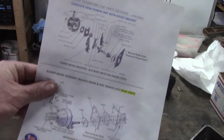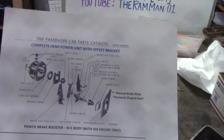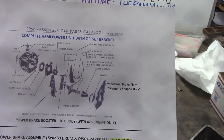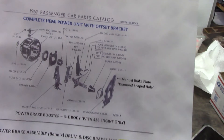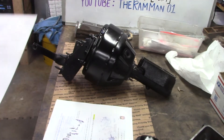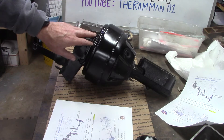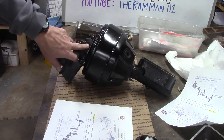Here's a blow-up diagram I've done for people. A lot of people say that they have a Hemi booster or Hemi brackets, but there's a whole lot more to that than meets the eye. That's what we're famous for — originally reproducing that bracket and many other parts. The Hemi booster has a different bolt pattern on the back designed for the brackets. It will not bolt directly to the firewall. The plates and the spread and the size are different.